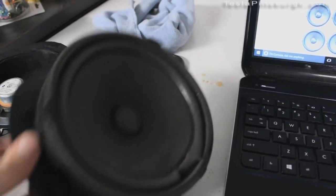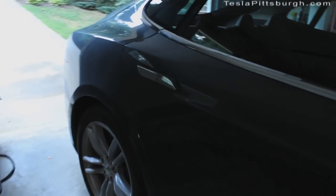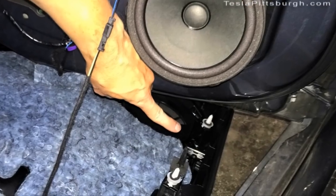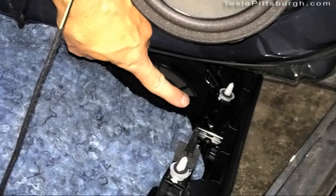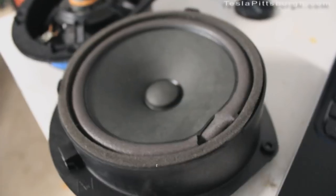Which is a good thing, because if I ever decide to go back, I'm going to need a new back speaker. Word to the wise: when you're popping the back door panels, right between the two fasteners, right next to the speaker, is an alignment post of some kind. And that post, when the fasteners break free suddenly, is in a prime position to go right through your cone. So have a helper standing by and holding on to that panel for you.